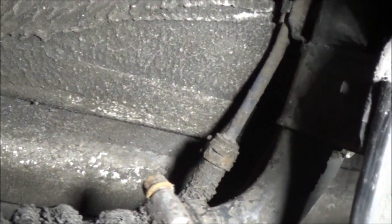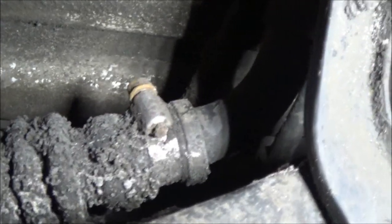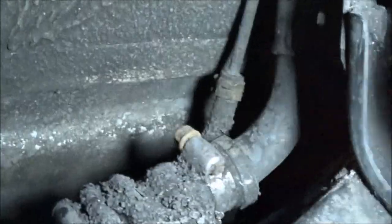The line that comes from here, it's up in here — right there. There's that, and then there's two smaller lines — there's another one right there you're going to have to take off. But this right there is a ten millimeter. And I can tell this has never been changed because when they built these trucks they put all this stuff in, then put the clamps on, then put the bed on. So as you can see this clamp is pointed up towards the bed of the truck, so I know this has never been out. When someone takes it out like I'm going to do, I'll turn it around so it'll be pointing out this way — same with the other clamp on that small hose right there.